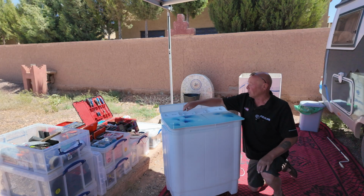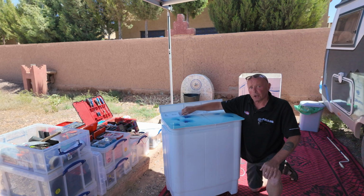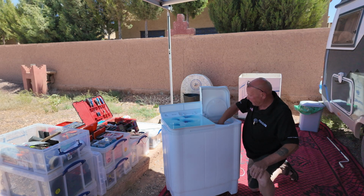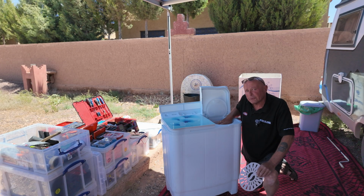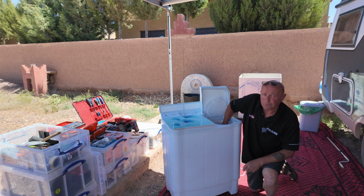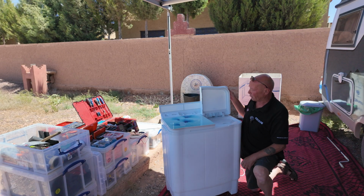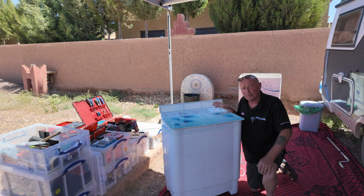Now when it comes to the controls, they're all pretty basic. Let them finish its cycle before actually stopping the machine. When it comes to the spinner, turn the spinner to the off position, open the inner and outer door, take out the mat and fill the spinner to about 1/2 to 3/4 maximum. Then put the mat on top and push it down firmly on top of the clothing. Make sure you try to distribute the clothing evenly inside the spinner. Shut the inner door, make sure it's locked, turn the top lid down and turn the spinner to the required time for spinning.